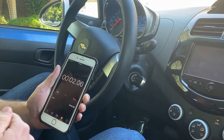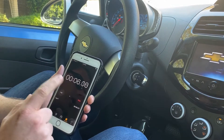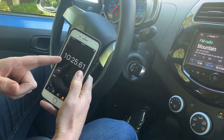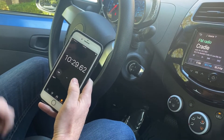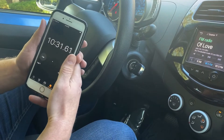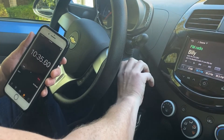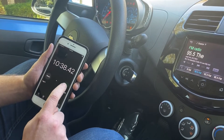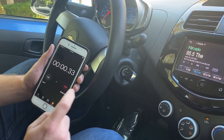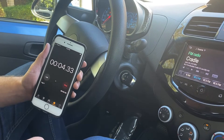I like to wait about 10 minutes 30 seconds. So we're coming up on our first 10 minute 30 second mark — as you can see, we just hit it. Now we're going to take the ignition and turn it to off, turn it back to on, and reset our timer. We're going to leave it in the on position for another 10 minutes 30 seconds.